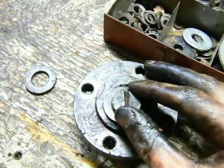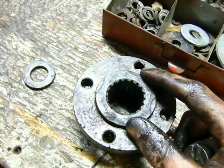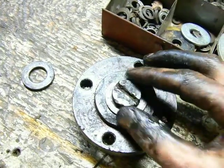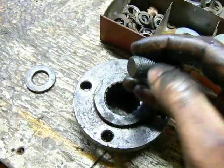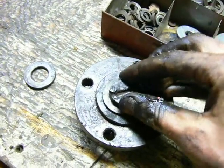I'm wondering if I'm missing a part, if something goes into the end of the crankshaft or something. If not, I'll just get a hefty washer and either find a big lock washer or just put a ton of Loctite on here and put some wrench flats and just crank this down real tight.